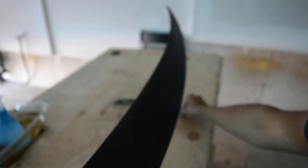Today all you're gonna do is take your razor blade, bend it a little bit like this so that the edges are lifted up higher than the paint surface, and then just scrape off all the extra runs. And make sure your paint has been dry for like a couple of days before you attempt to do this.